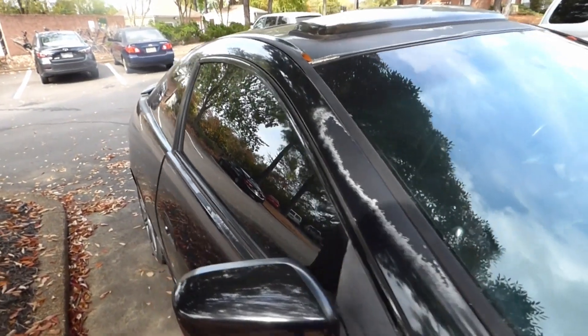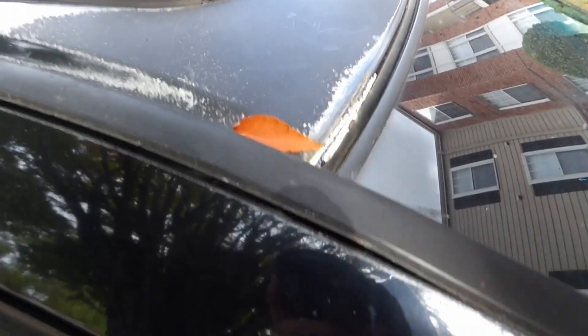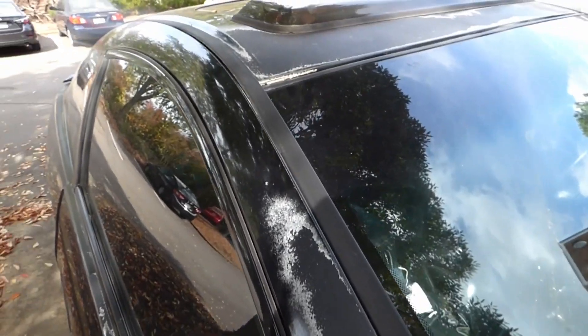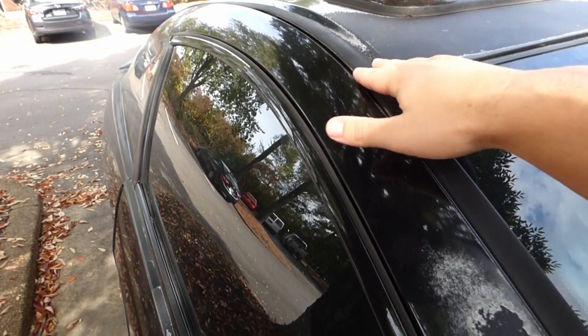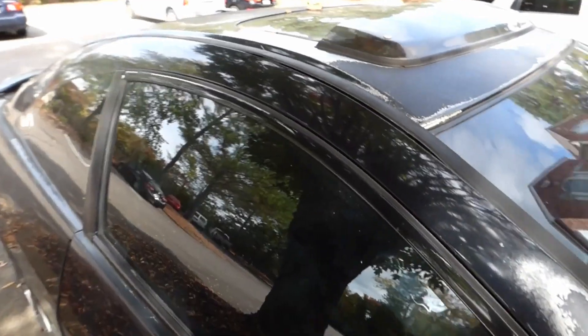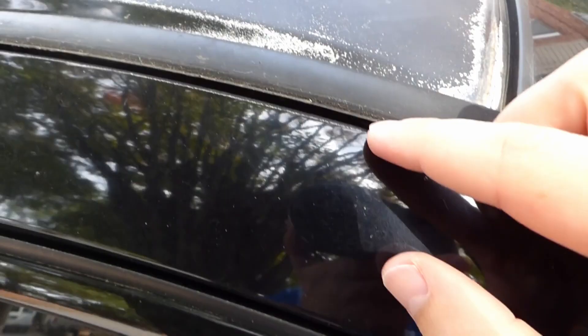But I used silicone, and you're not really supposed to use silicone on a car. So I actually got my windshield replaced, and the leak was still there. I had thought it was along the windshield seal — that wasn't it — although it did help a little bit, probably because I put it up here on the roof channel, which turns out is most likely the issue when they manufactured the car.